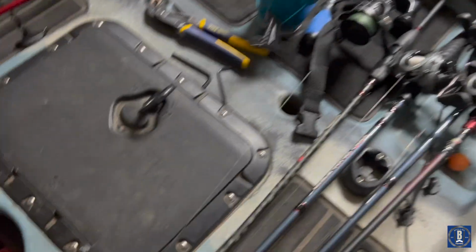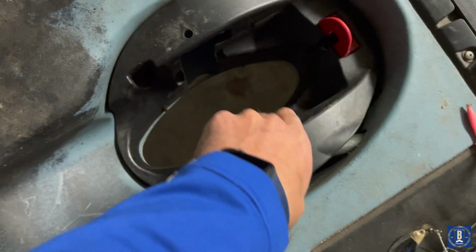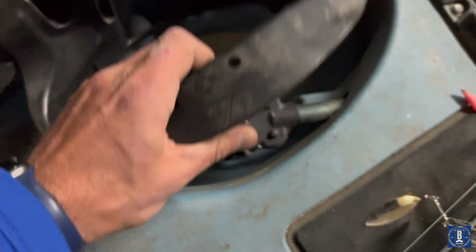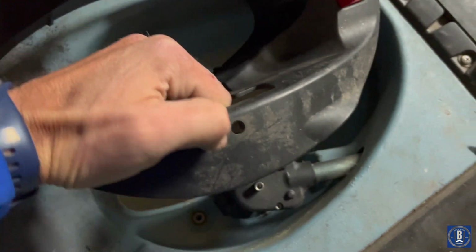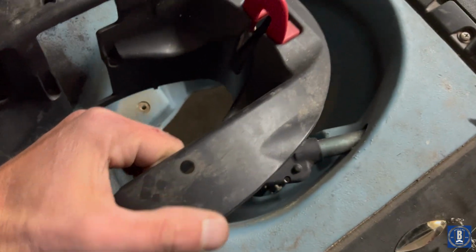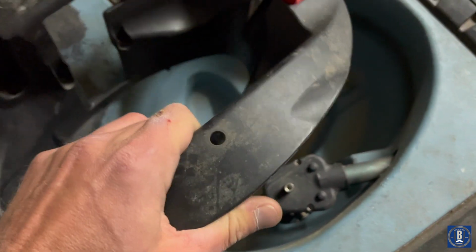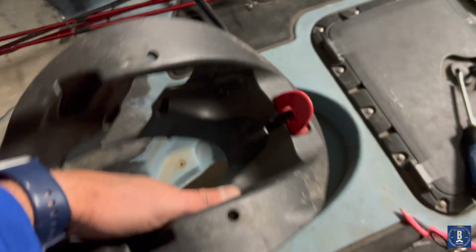So anyway, got my screws out, got this off here. Now let me see if I can get this casing off. So I got it off, and it was a little bit of a pain, but I tell you that part right here that I mentioned, this is not a screw. It is not. As you can see at the top, that's where that sits on, right? That was the hardest thing to get off. So what I did is stuck a screwdriver underneath and kind of twisted the flathead screwdriver, and it just twisted enough to get it over this. And once that came off, I just reached down and grabbed the bottom like that and just pulled around the gear, and it just popped right off.